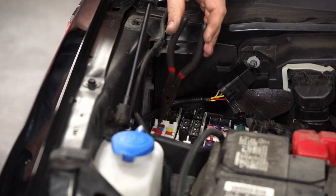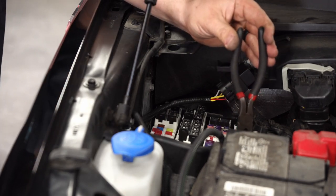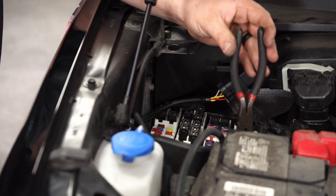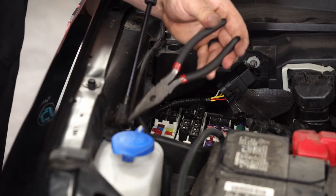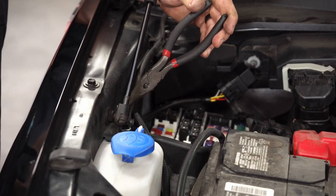To get this wired up, you're going to tap into three locations. The first is your fuse — it's a dark burgundy wire all the way towards the outer passenger fender well, and it's a 7.5 amp fuse; that's where the fuse tap goes. Right behind it, we've mounted the relay onto a factory stud using a 10mm — we removed the stud, put the relay mounting bracket on to keep it in the same spot. For the actual power wire, we're going to mount that onto the first stud on the power cable, and the ground is going to go onto the ground point on the fender well using a simple 10mm bolt.